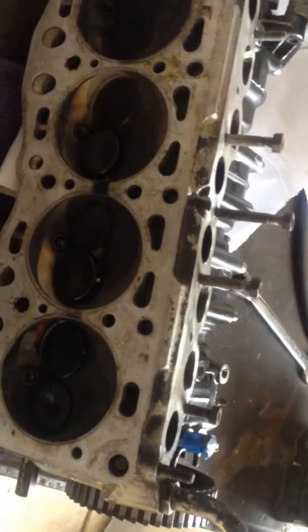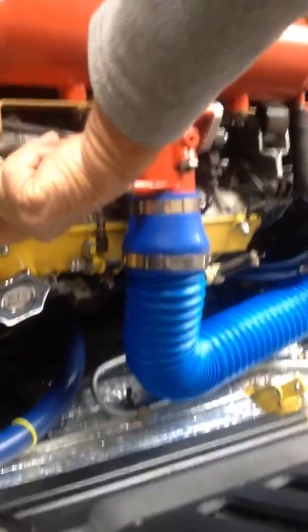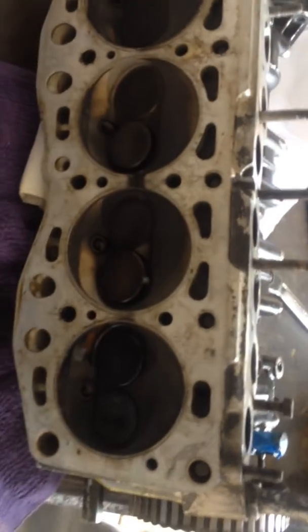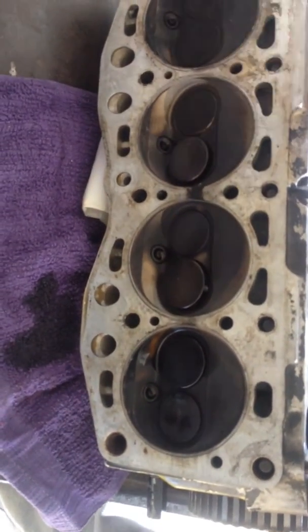I'm going to 86 it anyway. Usually the timing mark is up — I will show you where the timing marks are. Right here, yeah, I've got the plate. It would be to the right of the valve cover — this would be about it, about right. So maybe you're on right — I've got the plate sitting in the bucket right there. So at this point, number four would be top dead center, and that would be firing.